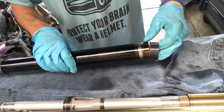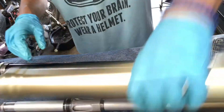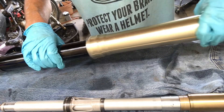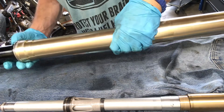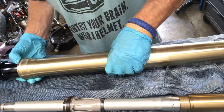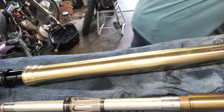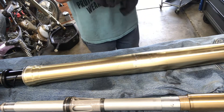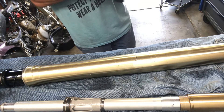Then your outer bushing and your inner bushing — tada. Now put them together and go to where the fork seal starts to set in. I'll have to change camera angle so you can see. A fork seal driver is necessary — if you use anything else you're probably going to tear your fork seal, and I told you so. For this one it's a 48mm — I'll have all the specs in the description.